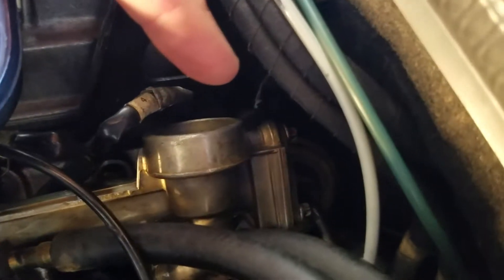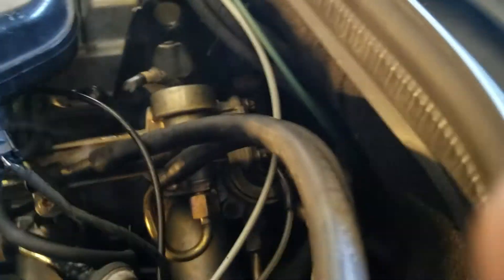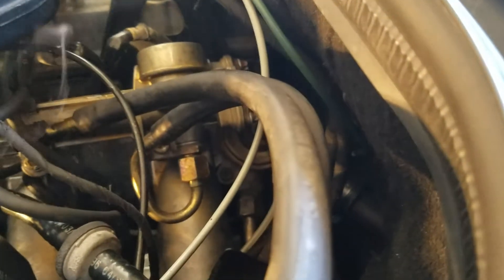I'm getting quite a bit of smoke coming off of there. I don't know if you guys can see it, but I'm getting a bunch of smoke coming out of the PCV valve. You can see it coming back on the underside of this end of the fuel rail, right back here. That's the PCV valve. I knew that that was going to be leaking because I cracked it. It goes in with two 5mm hex bolts. Nothing else down by the PCV valve is leaking.